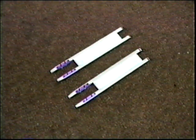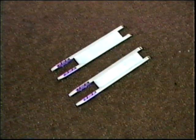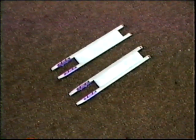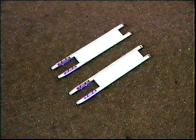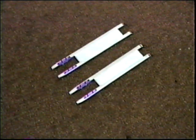Well, I gave him a nice quick sanding. Now keep in mind from this point, if you're going to use a four stroke, for sure, and these are, one of the choices you have is once you know the tank height, or roughly what the tank height is, and the center would line up with the needle valve, of course, you really should glue the shim in place at that point in time. It would just make the nose even more rigid.